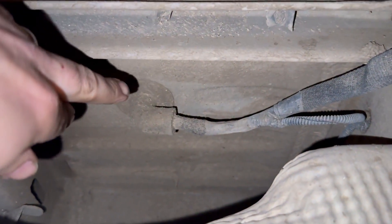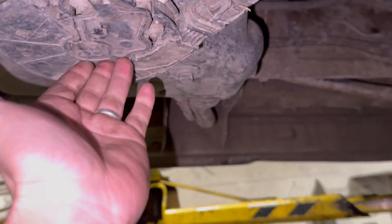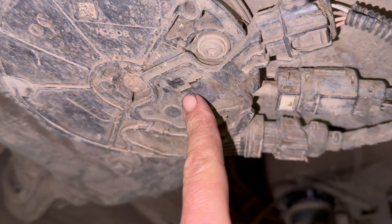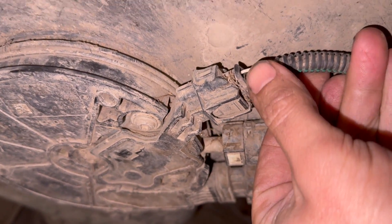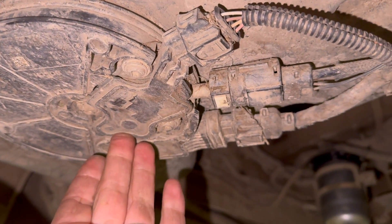...from the inside just comes down and runs along the side of the tank to underneath. On the pump here, this connector is actually the reductant heater — heater one — and those two wires, the brown and the white, are the two wires to that. I kind of knew it was okay so I knew there were no issues there.